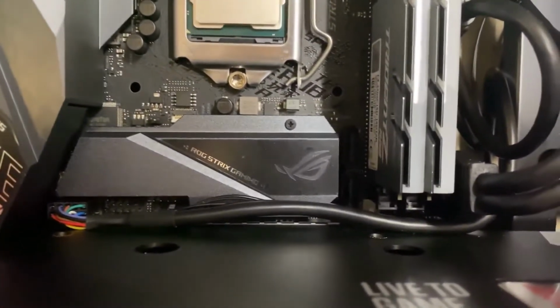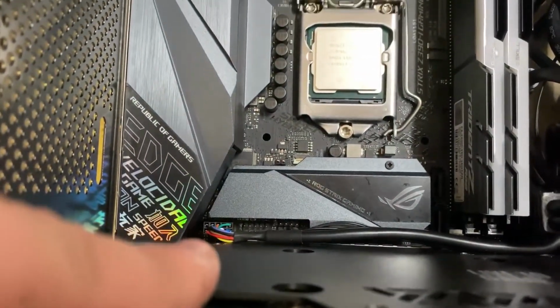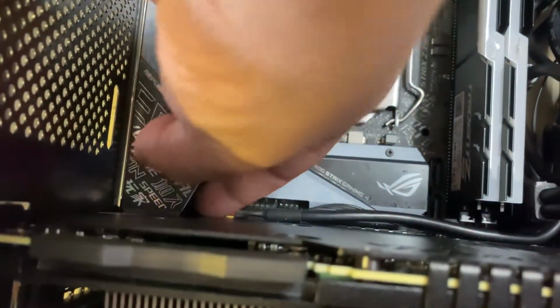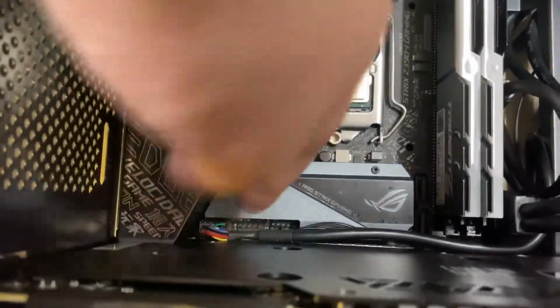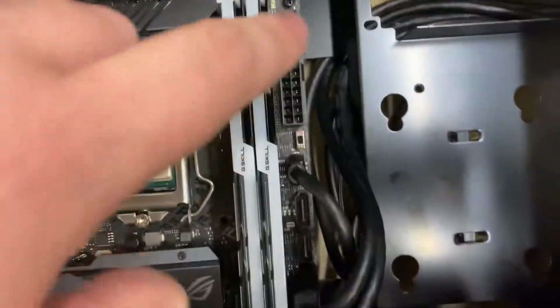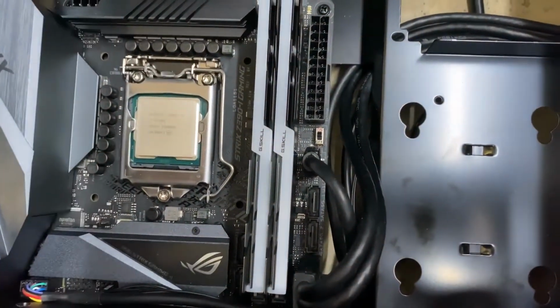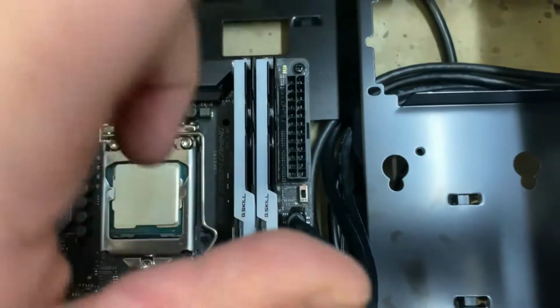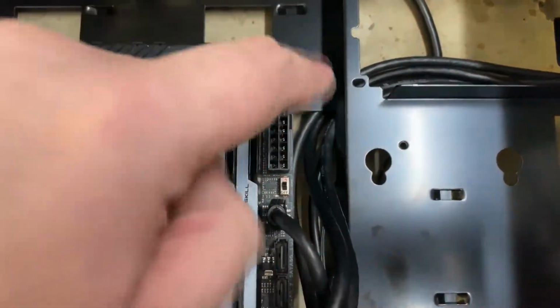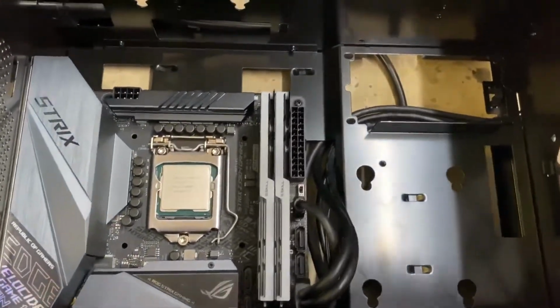Okay, so I've done my cable runs. They're not great, but these small wires I usually just tuck out of the way for the reset switch and power switch. In this case, there is a hole, but you just can't get the cable through on this type of motherboard. So that's why it's having to be run through here, which isn't great, but remember I've got this massive tower cooler that's going to be on here in a minute, so that's not a problem. It is a modular power supply, so I think what I'm going to do is get the power supply out next and put the power into our motherboard, just the power leads, and then we're ready for the cooler. Hell yes.